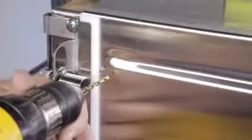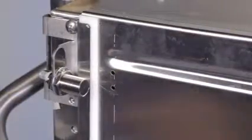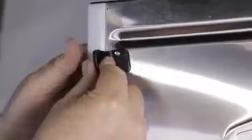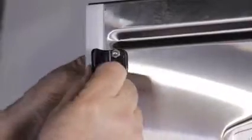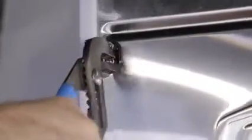For older doors that do not overlap on top of the hood, mount target to align with the door switch. Mount target with the 2 screws and nuts supplied. Place the screw heads on inside of the door and tighten securely.